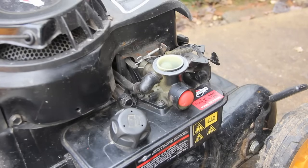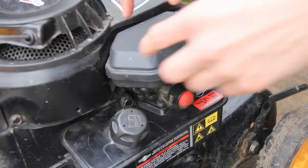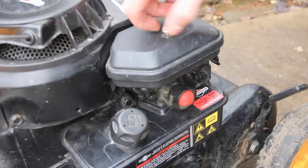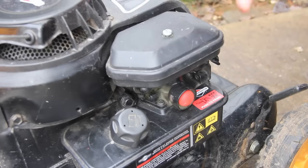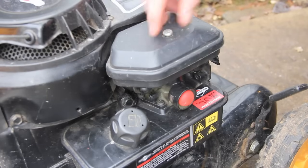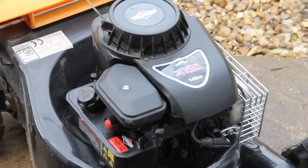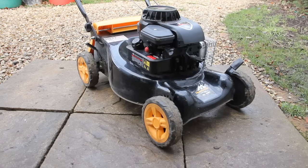Finally, you can put the air filter back on. Make sure you put it on the right way around, because it's a common mistake to put the V-shape at the front. The correct way is to have the flat side at the front. Once you're done, you can re-attach the spark plug and start it up. Remember not to start it on top of anything — for example, your spanners or tools — because it will fling them out. Make sure you test it somewhere it's not going to hit anything, preferably on the grass.